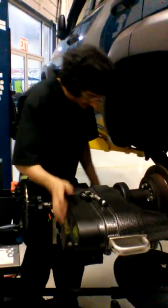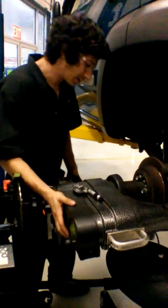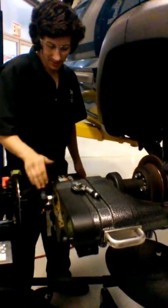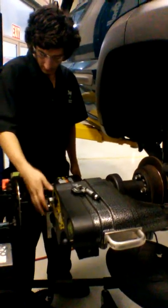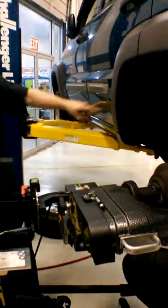We're going to get our machine lined up and kind of stabbed in here. We're going to lower it and make sure it's nice and level with our adapter plate. Slide our lever in and tighten her up. Make sure it's nice and tight. Go ahead and get our machine going — it's going to turn the other wheel as well since it's turning the whole mechanism. We want to make sure we see our ready-to-cut and optimum lights on. Then we're going to loosen up our cutters, open them up, and make sure they're nice and even so that one isn't angled in more than the other — you want them both angled the same way.